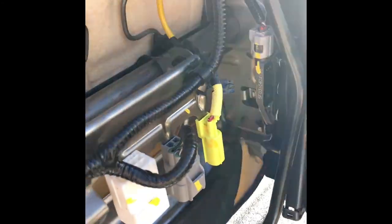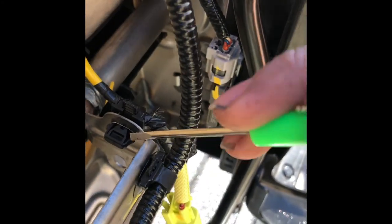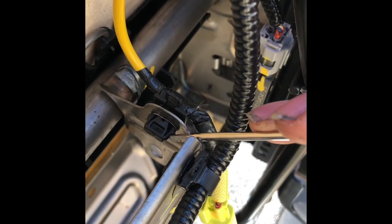Now take the seat, move it around, and set it just like this. These are going to be connected — you'll have two of them. Flip this out of your way. You're going to need to undo the harness for the airbag to the seat. On the driver's side there is one more connector right here — you'll just unplug it, and the seat will have two connectors for the power seats. For undoing the airbag harness, use a small flat blade or pick. Go on the back side here, just on the inside, and you can see it move. Pull it out of the way.